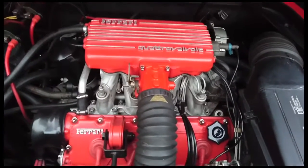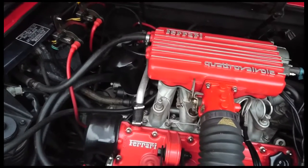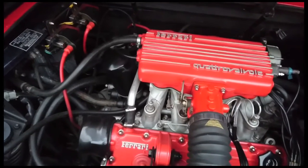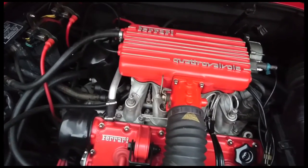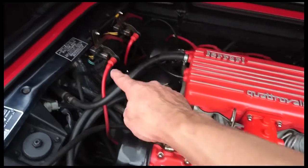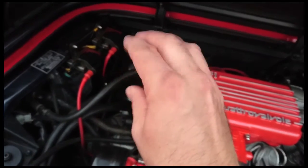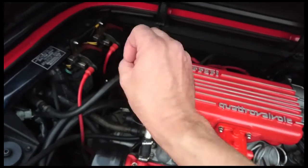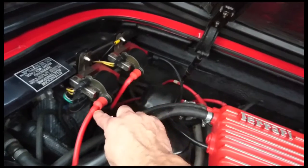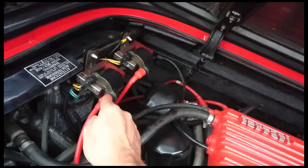Just to sum up the tests I've done. I used my little strobe light, which on the video doesn't come out properly because of the frame rate of the camera, so it looks as though it's flashing intermittently. But when I connected it to this cable here, which I showed you in the video, it was flashing constantly, very very quickly. When I connected it to that one it was also flashing very fast. This coil was originally getting warmer than that one, and the reason is because that plug wasn't fully home, so it was obviously building up a resistance.